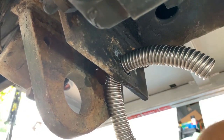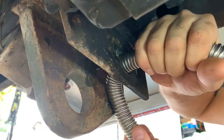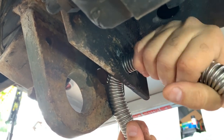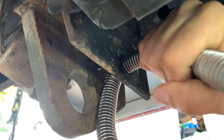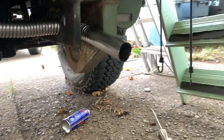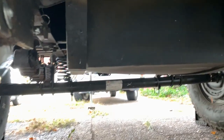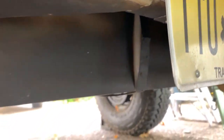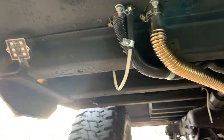This is why it took a little longer — I just wanted it probably too perfect, but it's becoming a pain. I promise you guys it's a lot easier, you just don't have to be like me. I just wanted it to look like a regular exhaust for a vehicle. So now I'm going to remove the muffler and put it back here behind the license plate so you don't see the muffler, and then the other half of that pipe is going to come up right here behind here.